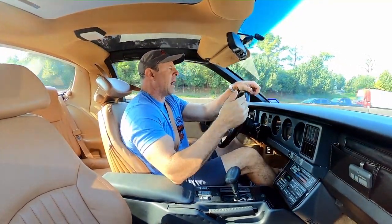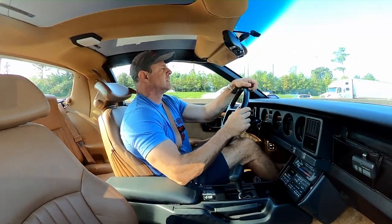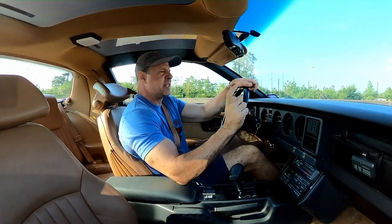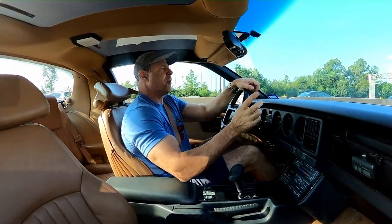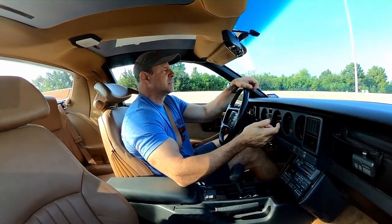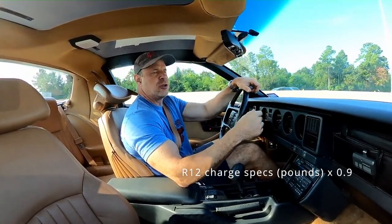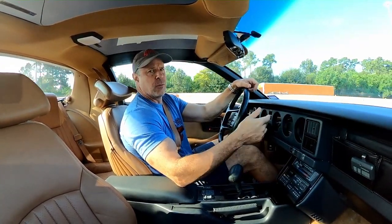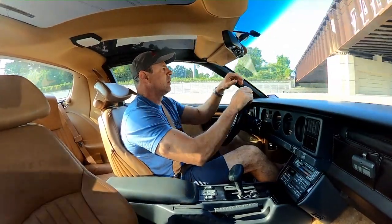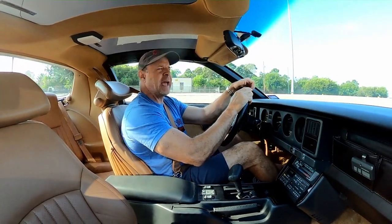I don't really know if all of that is entirely true — I converted the RX-7's AC to 134a and that's also really, really cold. Also, there's a conversion factor for how much refrigerant you put in: you can't just say the R12 system held three pounds so I'll put three pounds of 134a in. There's a conversion you need to do so you don't overfill or underfill and burn over the new system. I think this is a pretty good place to break off this video — it's getting a little long. I'll put this as part one and then part two, and then we'll jump over to the second segment. Thanks for joining me and we'll catch you on the next one very shortly.